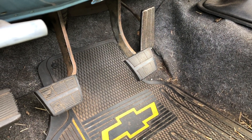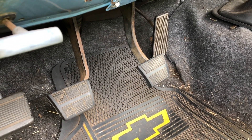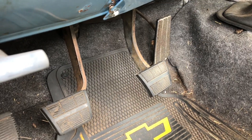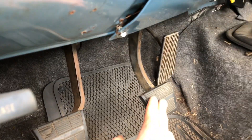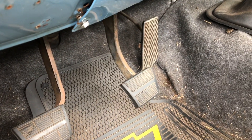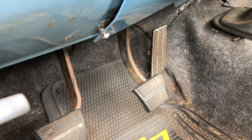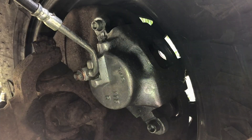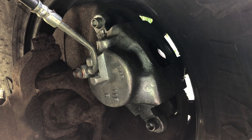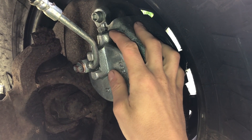The first step is to bleed your brakes as best you can — get all the air out of the fronts. My rears were blocked off so I couldn't bleed those. Next, have somebody sit in the cab and stomp on the brake pedal really hard about five or six times, and on the last stomp have them hold the pedal all the way down to the floor. Meanwhile, be underneath the truck and crack open the bleeder screws in the front.